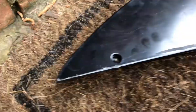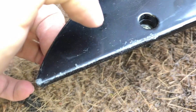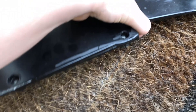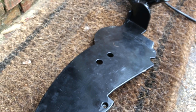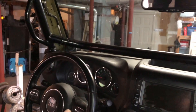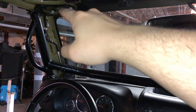Here's the driver's side pulled out for a close-up — you can see exactly where it was rubbing; there are fresh little flakes. It's rubbing on the bottom region and just a little bit more here. So I'm going to thin those spots out. After grinding down on the casting of the Jeep and the cage piece, I've got the driver's side A-pillar back in.